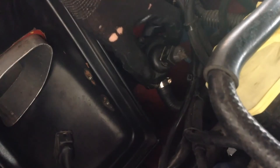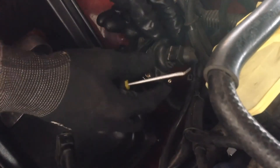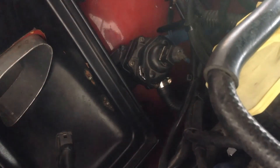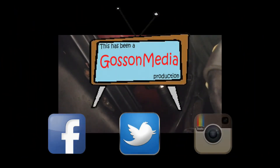I'm just going to clean this corner up where I busted it open, and put a little bit of ultra-gray sealant just around that seam and stick it shut. But first I'll try the speed and adjust it where necessary. So that's about it to adjust the idle speed control valve — you can fiddle with that until you're content with the speed you like. Thank you.